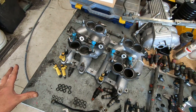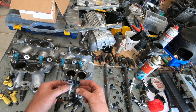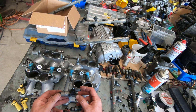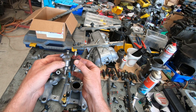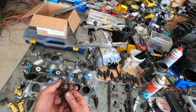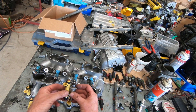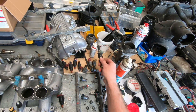Now — what injectors actually fit? The factory light purple and dark blue both fit nicely. I have some 7M injectors — or possibly 3S — which are 440cc low impedance. Here are some RX7 injectors: they look pretty much the same, slightly taller, different plug — but they will fit. Also a Nissan injector of some sort — physically looks good — it will fit.